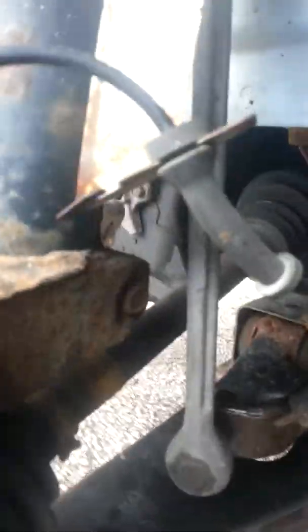As you can see I've already done the passenger side. I'm gonna go on the driver side — this one is just as bad. If you go ahead and wiggle it, you can see it moves real free, just like the one we have off. I was also looking at the tie rod end, but it's not that bad — this side is a lot better than the other side.